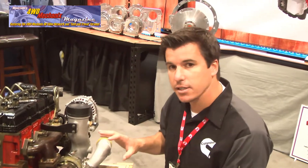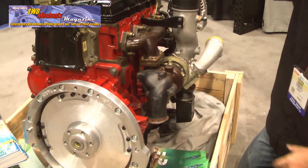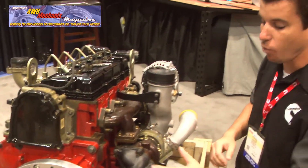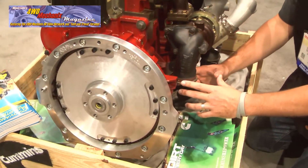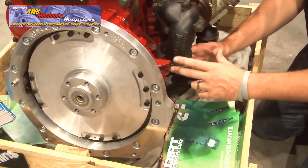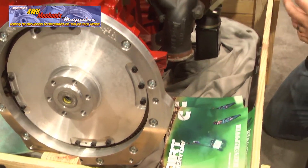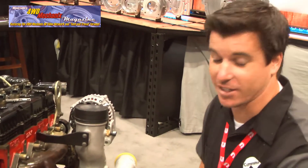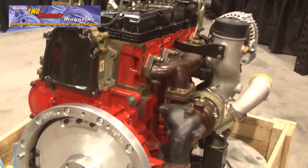This display engine is a little different from the first engine we're applying an EO for. This engine is missing an EGR cooler and a crossover pipe, but it's all still within the footprint of what is displayed here. For this gas-to-diesel emissions conversion, our downpipe from our turbo actually has a small passive diesel oxidation catalyst, or DOC, on it, and then it sweeps out right where your normal downpipe would anyway. It's a completely passive element that helps take the hydrocarbon smell off, works really well as a downpipe, is easy to bolt to, and stays within the footprint of the engine.